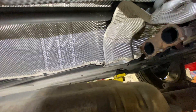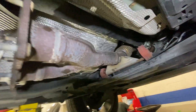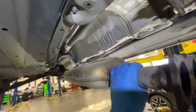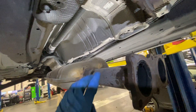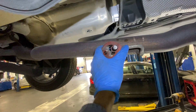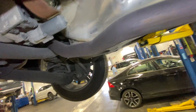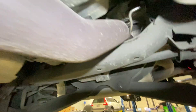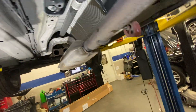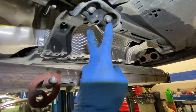If I remove those bolts, the shaft is going to hang down, so I don't want to do that right now. On the other side there are the other bolts. I lowered the exhaust halfway — that's as far down as it can go — and I removed it from the rubber hangers. Now I just have to undo those 10mm bolts and it'll drop down.